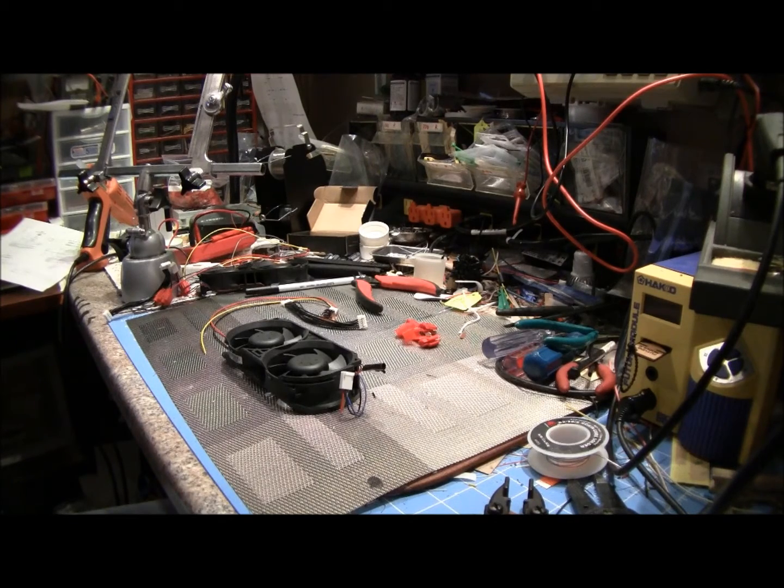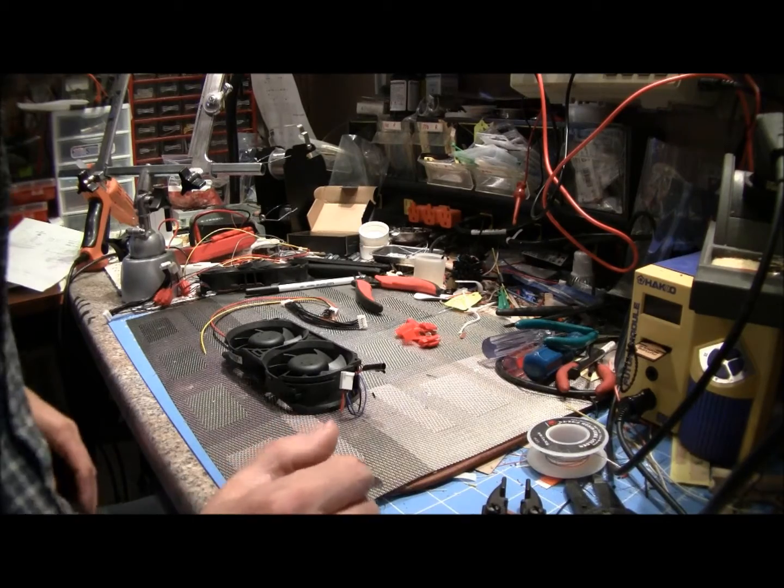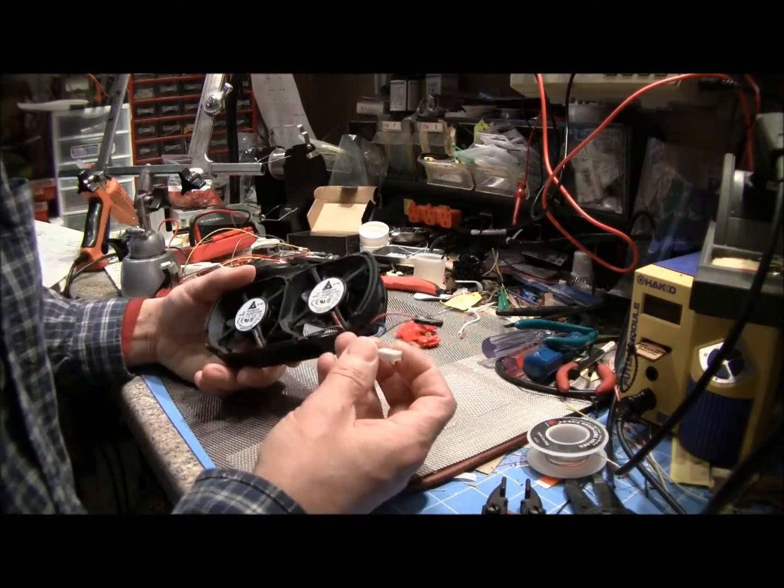What we're concerned about is the expansion and contraction of the board, which leads to the yellow light of death. And that's what our fan mod takes on. It's not that we want to cool our chips, which basically does no real benefit to us. It's cooling our console. Now, there's a couple different ways you can cool the console.